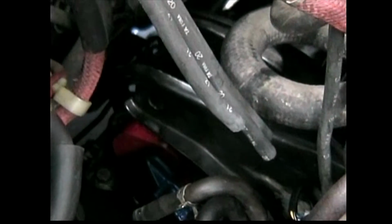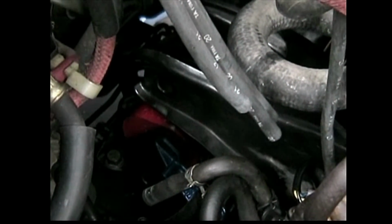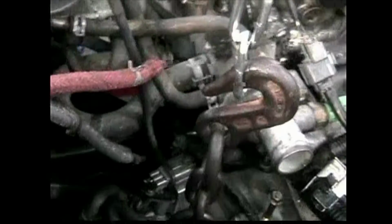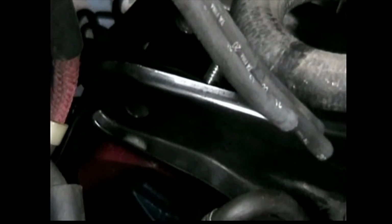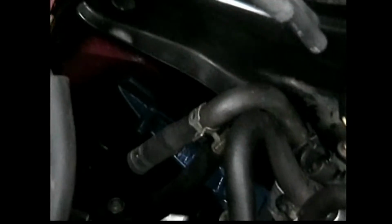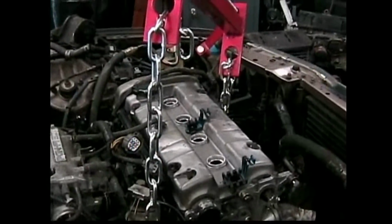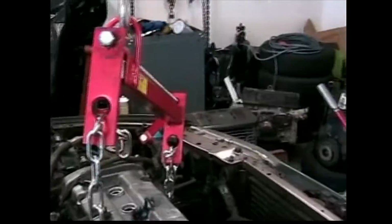That's our problem right there. That polyurethane mount is really hard to get that bracket over. We're just having a real tough time getting it all wedged in there. You can see the polyurethane mount there and the bracket that's sitting on top of it. That blue thing is a clamp to push the polyurethane together inside the holster. That's a wood clamp. We gotta take care of it and put it back. Yeah, we're gonna have to wipe the fingerprints off of it. It's gonna have grease all over it.